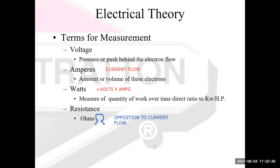And of course, if I had a long distance to transmit that electricity, I would need a thicker wire. For all intents and purposes, I need a thicker wire. Otherwise, it couldn't handle all that electron flow. So that's why I said earlier, if I'm going to run wires around, the longer I have to run that wire, the bigger the gauge size, the lower that number. Maybe if I only had to run it 6 inches, I might do a 22 gauge. But if I've got to run it 3 feet, I might go down to a 12 gauge. All right.